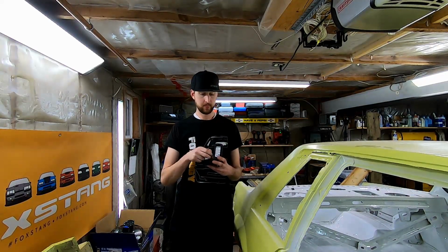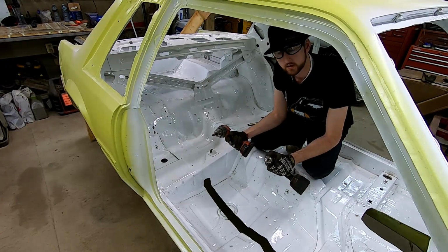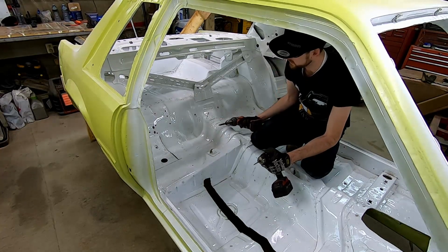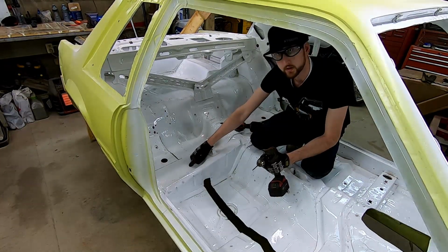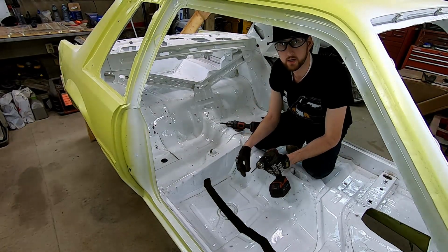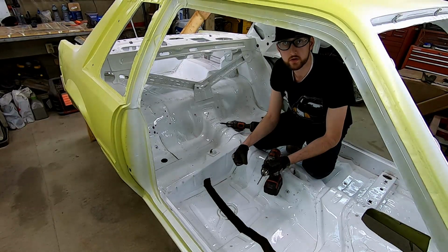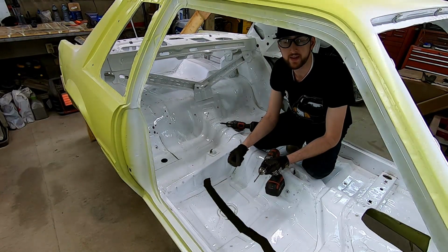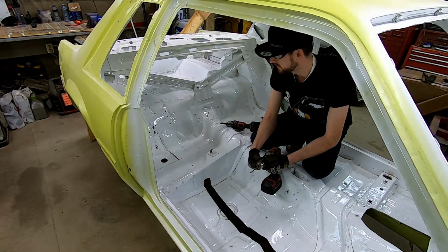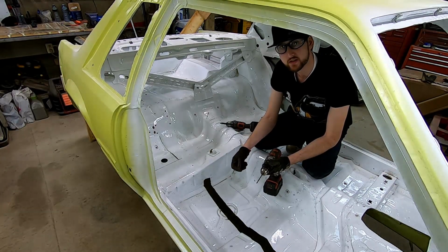a fresh spot weld. So here I have 2 drills. One has my 3/16 pilot hole bit, and here I have the one with the spot weld cutter. So I'm going to go into each of these spots and just place a bit of a pilot hole to keep the spot cutter from actually walking back and forth. There is actually a couple other styles of spot weld cutters that instead of having a spring-loaded pin on the end, they actually have a drill bit in the end. Could be very useful as well, but we don't have that, so I'm going to work with what I have, and we're going to get into this.